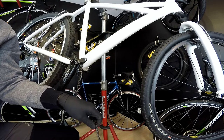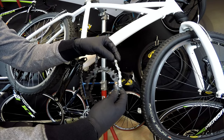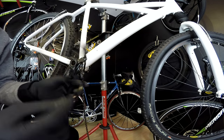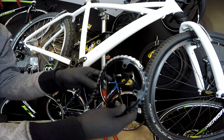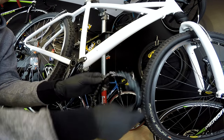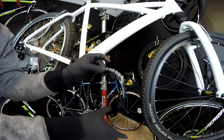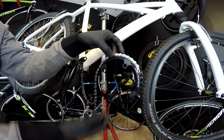If we look at the regular chainring, it will not hold onto the chain at all because it's not designed to do that job. This one here is Argon Components, a Polish brand. Even the very popular Race Face would not hold onto the chain as well as this one. You may want to try different chainrings and find one available in your market that really holds on to the chain and prevents chain drops.